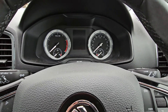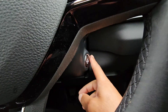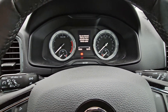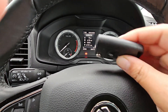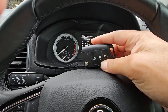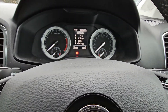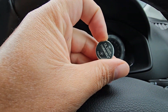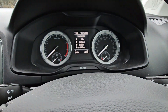In today's video I'm going to show you how to get the Skoda Karoq started when you are getting that message. The reason you're getting that message is because your key battery has more than likely gone flat. The battery you need is a CR2025 coin battery.